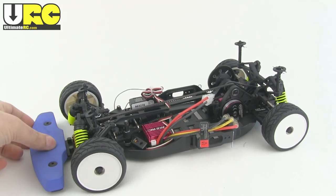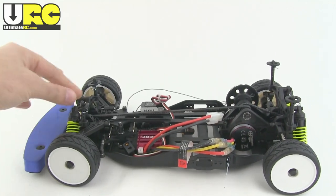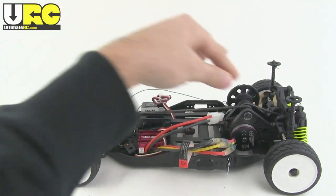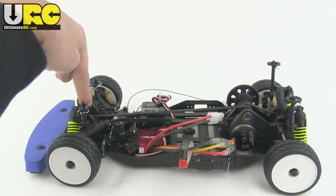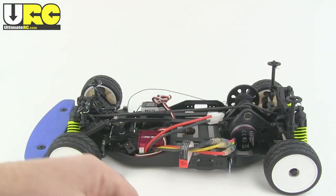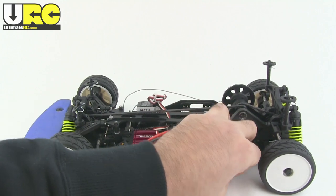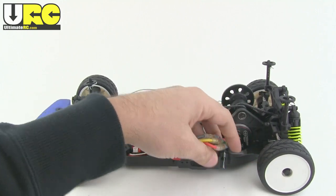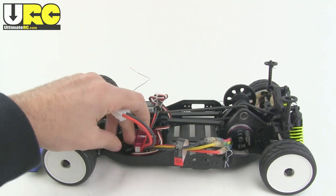I think the ride height is a little low in the front, and a little high in the rear, and too springy. So the out-of-the-box setup is off for some reason on such simple, basic things. Why would they do that?